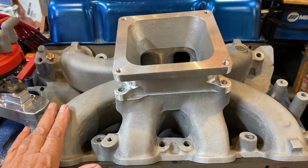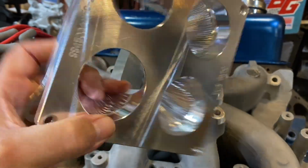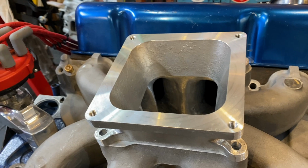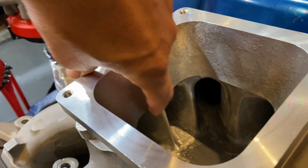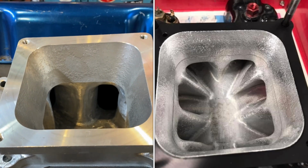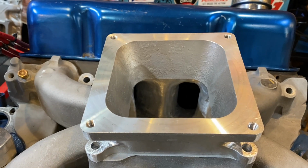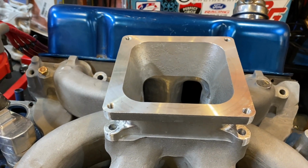Brent Likens used an adapter which I think he actually used this one, the high velocity heads, Super Sucker, which I love, the way that looks. But I think he may have used that for the dyno test, but I'm not really sure. But in this case, I'm going to port this anyways to match. You can see there's quite a lip here. There's probably at least a 1/4 of an inch, 1/8 to a 1/4 of an inch around the whole thing. And I'm going to try to blend that in. When you look at this picture here, this is from Tristan Trickus, or Tricky from Australia, who's a head guy. I had him on as a live chat. So I'm going to kind of try to emulate this appearance. That'll be the next stage of porting.